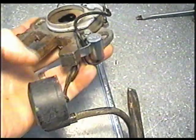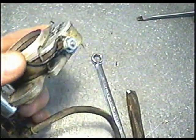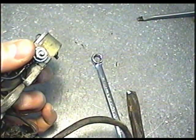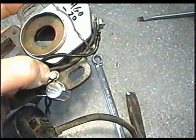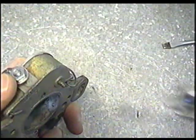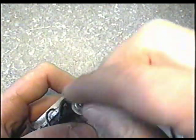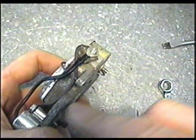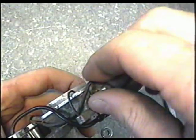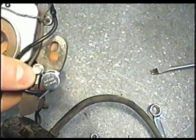When you go to remove the coil completely from the plate, you'll notice there are two wires coming from the coil. One wire goes to the points, which you have to remove the nut from, and one wire is grounded to the plate underneath a small bolt. With an 11/32 wrench, simply remove the nut at the points. One of the wires goes to the condenser and the other to the coil, so just remove the wire. Next remove the quarter-inch nut rod here.